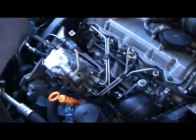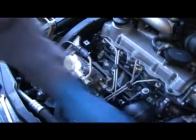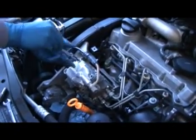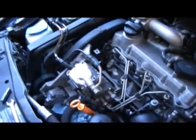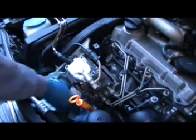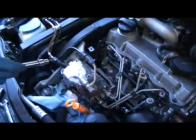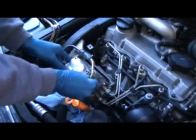It's really important to use a high quality Torx driver on these, more so on the head bolts than the top cover bolts or any of the quantity adjuster bolts. But the head screws, 2 of them are really shallow and require a really nice fitting socket. If you buy a real cheap set, you can break off the bits in the sockets or round off the heads of the bolts, making it really difficult to get the head bolts out. So, something Craftsman level or above, to make sure that you don't round out the bolt heads or break off the socket.